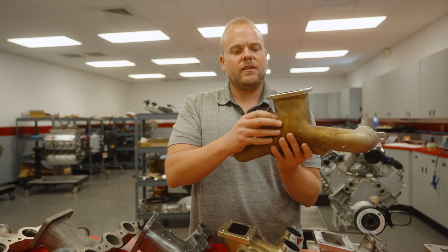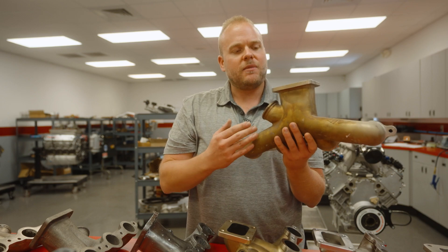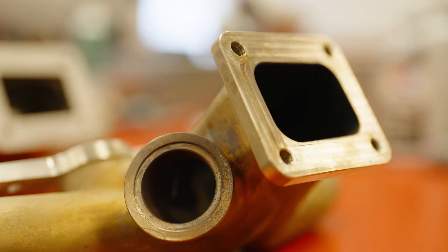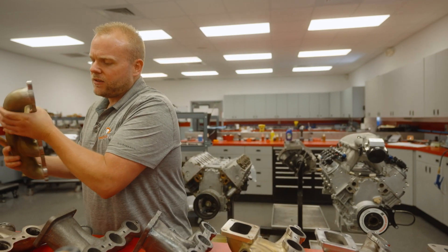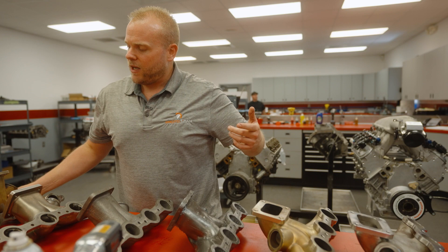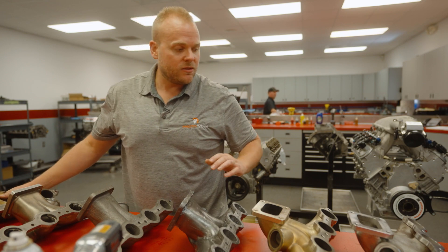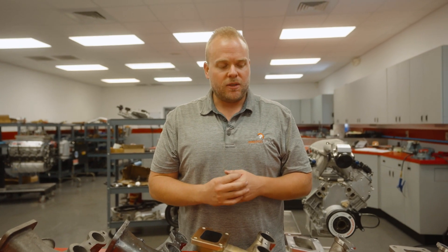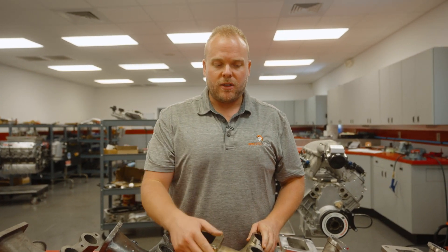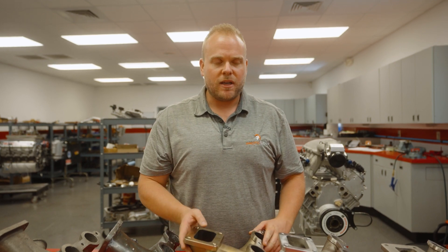You'll notice the wastegate flange is positioned after the merge — that's to give maximum priority of the exhaust gases going to the wastegate for easy boost control. If you watch some of our other videos, you can see we're actually able to control boost all the way through the range using just the onboard air that the turbochargers are creating. No need for external air to hit those numbers, now that we have a boost controller on there, and a lot of that can be attributed to the priority wastegate configuration we put into these manifolds.